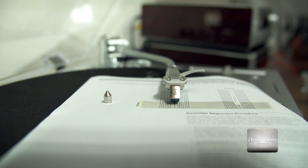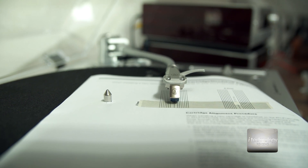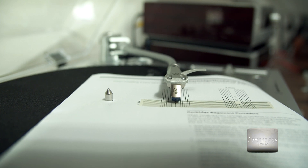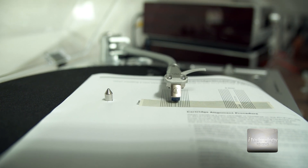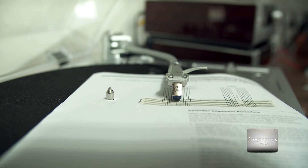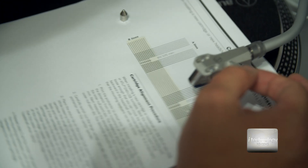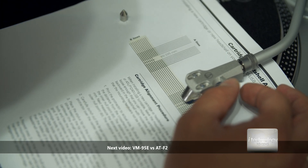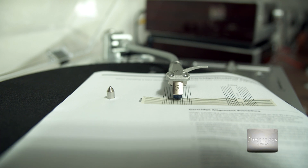I spent an hour and a half aligning it. From the side angle you can see the bottom of the cartridge — that base must be perfectly aligned. This angle is the best position to align it without needing to pay a professional, because this operation is very delicate. Then move to step B lines and verify the cartridge is parallel there too. Once aligned, you can tighten the screws — don't fully tighten them until your adjustments are complete.